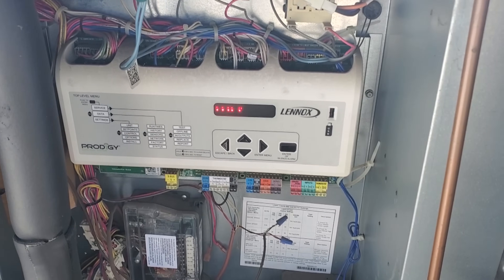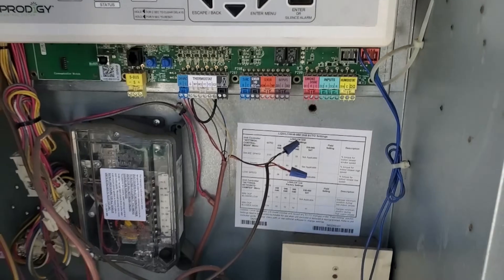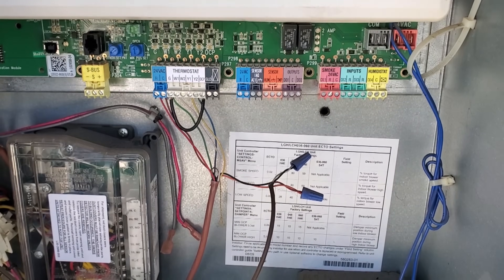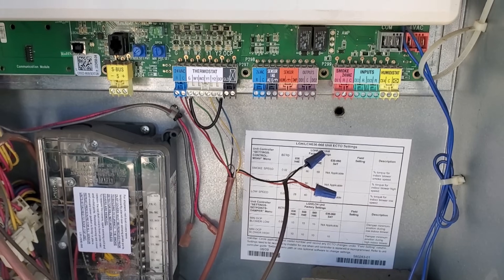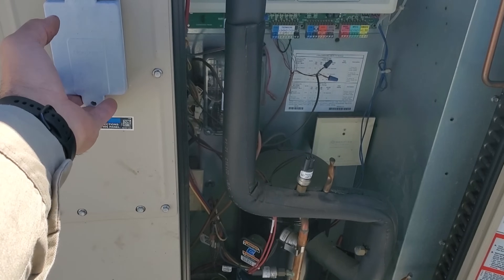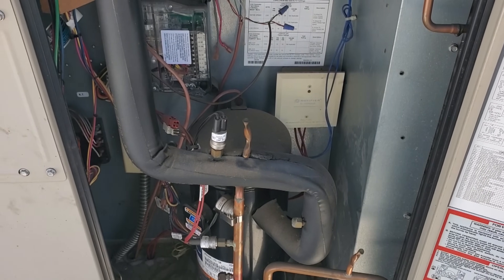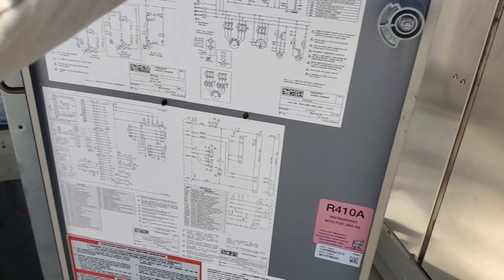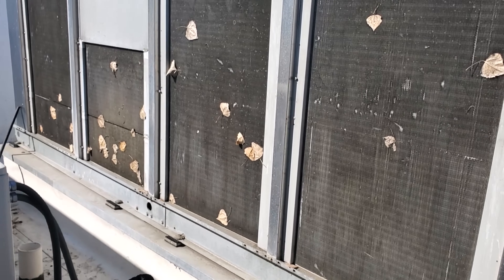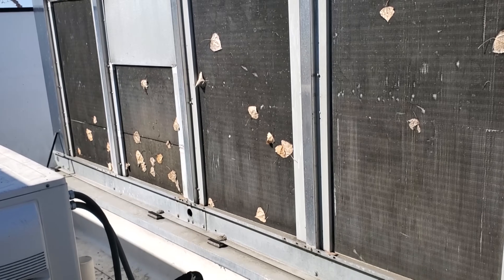This is the fun display that you're not going to be able to read on camera, but it says idle. Down here we have no indicator lights showing that the thermostat is calling, which would make sense because it's jacked up. I don't see anything jumping out at me saying there's a problem here. The condenser doesn't look too bad from the surface — got the refrigeration rack right here, and it actually doesn't look that bad either. Just a little lint, but overall looks pretty good.